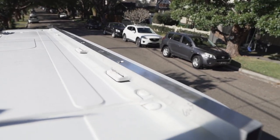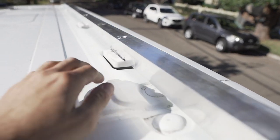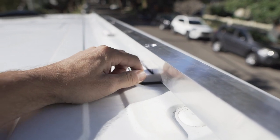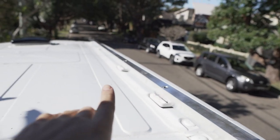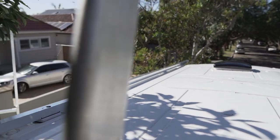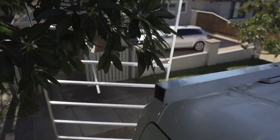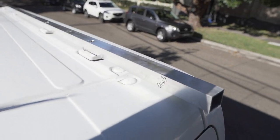This is how the two frames work going down the side of the van. The spacers hold it up off the roof a little bit, and the rubber liner underneath water-tights the whole thing and raises it up. I needed it to raise another half a centimeter to bridge the gap so it doesn't touch the middle of the curved roof. Now I'm going to try to get the frame up by myself and set it on top of the two rails.